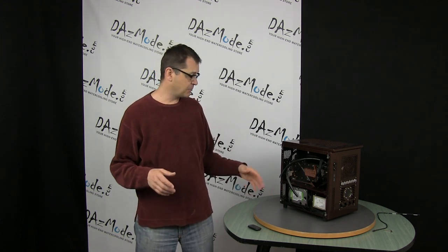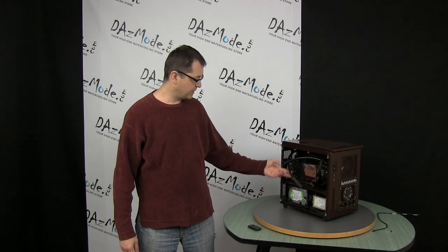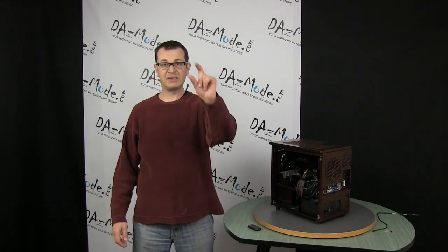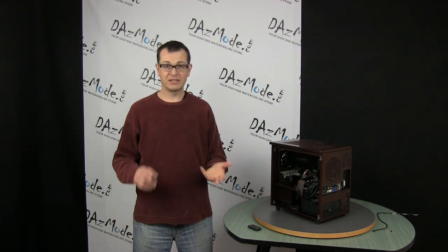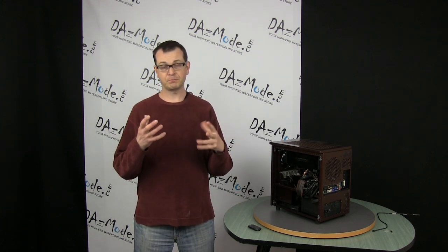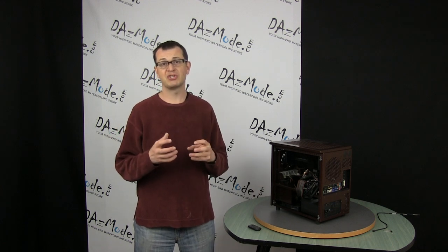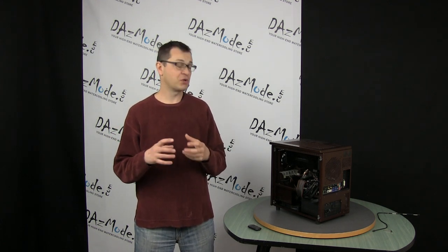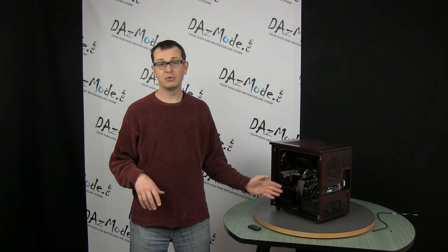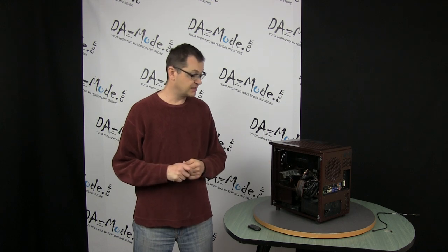Today I hope to finish my tube wiring. Most of the loop is in place — I only need to connect the GPU to my pump and reservoir. The other side is a little trickier because the spacing is very small between the CPU, memory block, and radiator. The memory block itself is a flimsy construction, so you can't push too much pressure or you can break the socket.